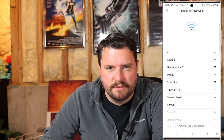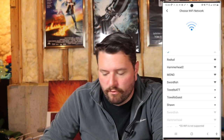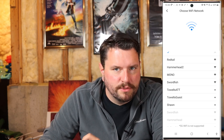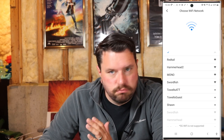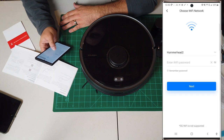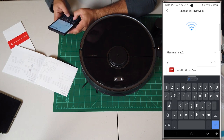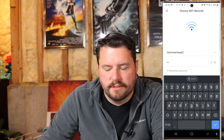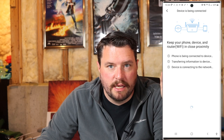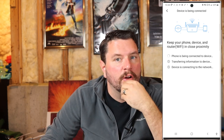Select your Wi-Fi. I have my Wi-Fi subdivided into different sections — I have an IoT network for devices that are only going to be connected to the cloud, and they can only communicate with my Home Assistant instance. I'm going to connect it to my dedicated Wi-Fi for IoT devices. It looks like it only supports 2.4 GHz, which is pretty standard on IoT devices. This sub-network only allows the IoT device to communicate with the cloud — no devices internally on my network. It's just a security thing and I'll probably do a video on that later.